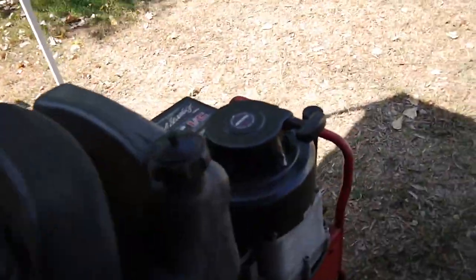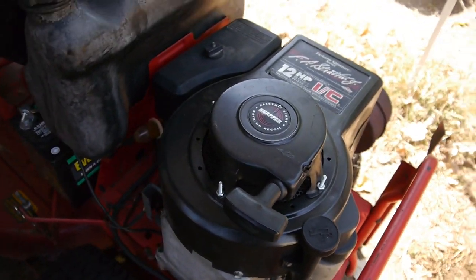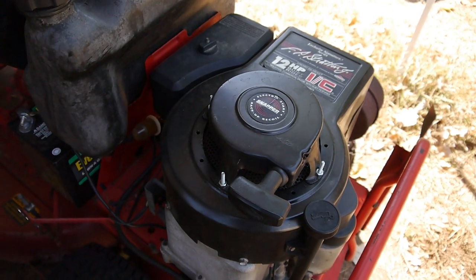it was running okay. But I found out every time when I crank it up and I shut it down, and then I try to crank it again, it was like it was misfiring and backfiring. And it turns out, I don't know if it's happening while it's running or when I'm shutting it down, but it keeps shearing the flywheel key. I haven't taken it apart right now, because this will be my third time. And I'd almost bet that flywheel key is sheared off again.